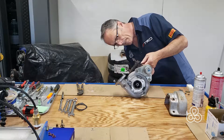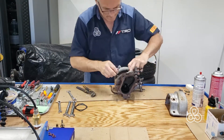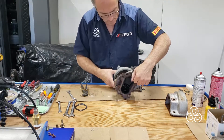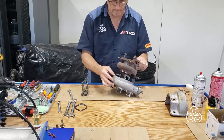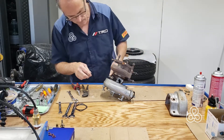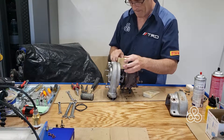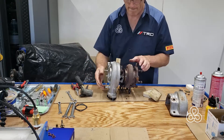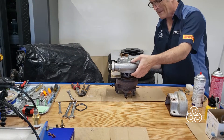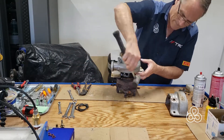Once the peripheral stuff is off, the first thing that comes off during breakdown is the clip ring that goes around the turbine housing and the center bearing housing — that allows us to separate them. Then there is a big snap ring that holds on the compressor housing; once you pop that out of the groove it's free. You want to make sure these impeller wheels come straight off, or you'll break a blade if they come off at any angle, so use wedges on both sides.